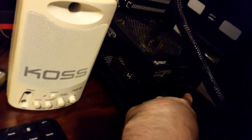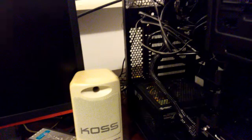Okay, so around on the back here, I had 2 of these SATA 3 connectors, and this one had an elbow end on it. So I used that one because we'll be putting the case cover back on. And I had another accessory SATA power lead, the cable that came with the power supply. It only has 2 ends and it's shorter, but I used it here. So there's this spare SATA power in there if I ever need it. And they both go to the power supply, and the SATA is this shiny guy here, and it goes into a slot on the motherboard.